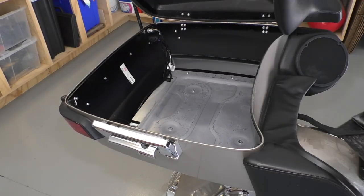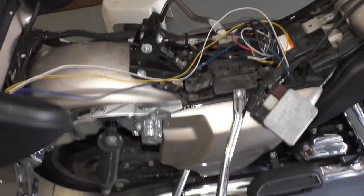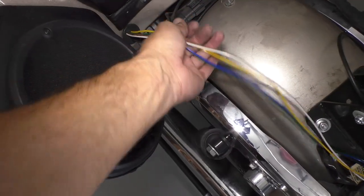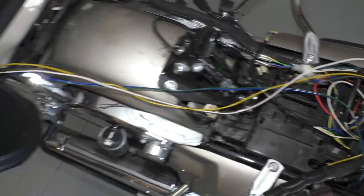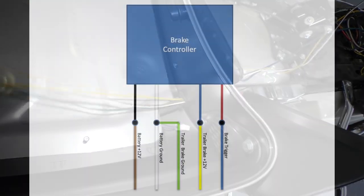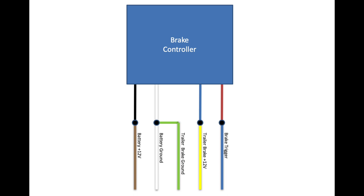You'll need to run five wires into the trunk, and if you can run them through an existing opening, that's your best option, of course. Be sure to give yourself plenty of wire length to work with on both sides. Unless you have a cabinet full of wire and you can be choosy about your colors, you're probably going to be connecting wires of different colors in your installation. I'd recommend that you put together a little diagram to keep them straight — something like this one. These are the wire colors on the controller, and these are the wire colors I'm going to be using in my harness.